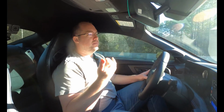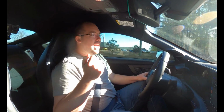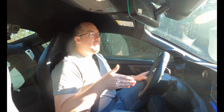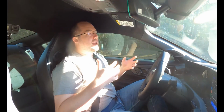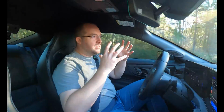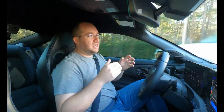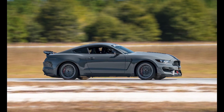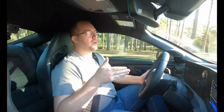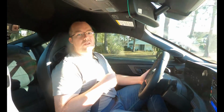Now, on the flip side, if you were the kind of person that is trying to get every millisecond possible out of your Mustang, then MagneRide probably isn't for you either. Think of MagneRide as something that is great at doing everything, right? I don't want to say jack of all trades, master of none, but it's kind of along those same lines. If you're going to the road course and you are going for every tenth you possibly can, then you're going to want to add a set of coilovers on there.